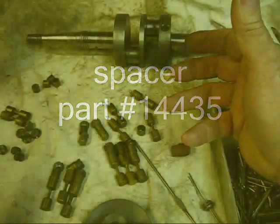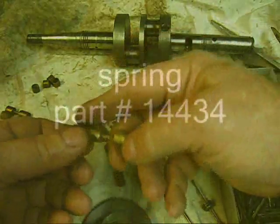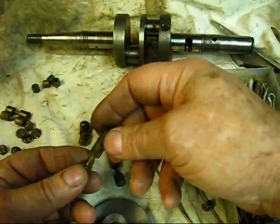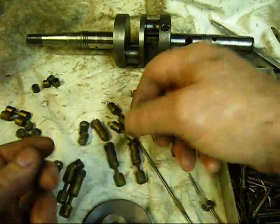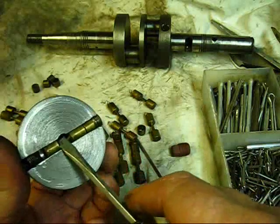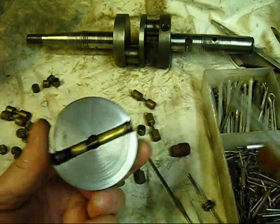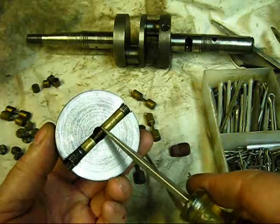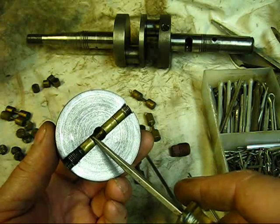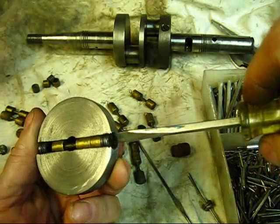The spring in the Maytag book — number 14434. This right here is the way you want them to work: a real tight assembly. With this cutaway, at this gap right here, the further you turn this screw in is the further you move that gap down on that intake hole. That spring uses centrifugal force to pull that open and close that hole.